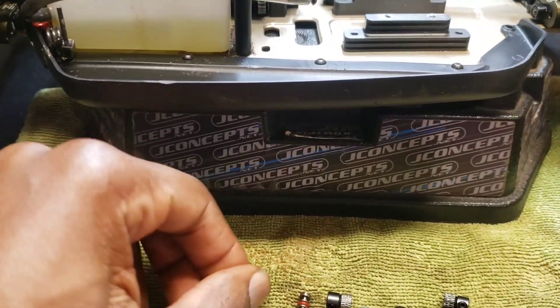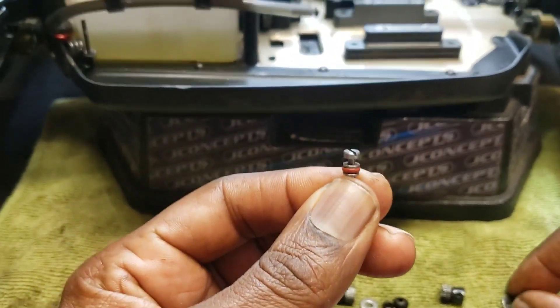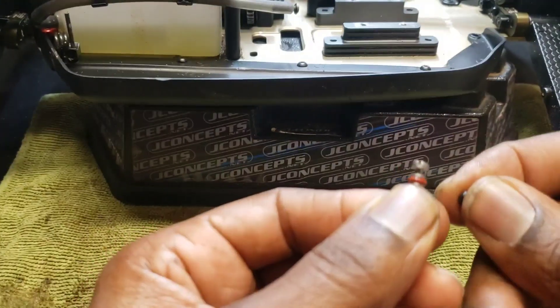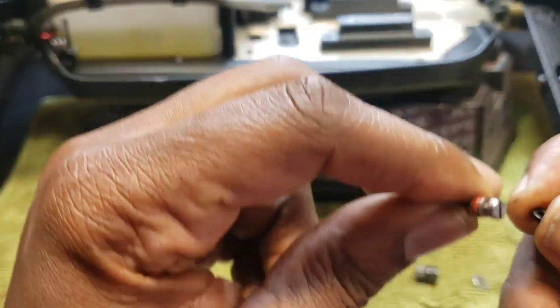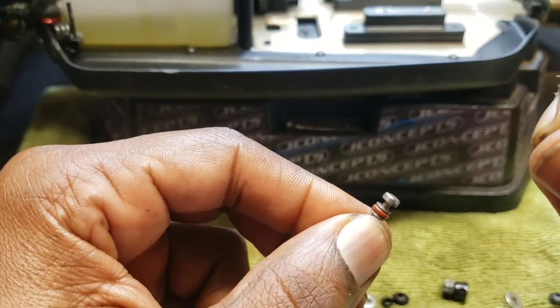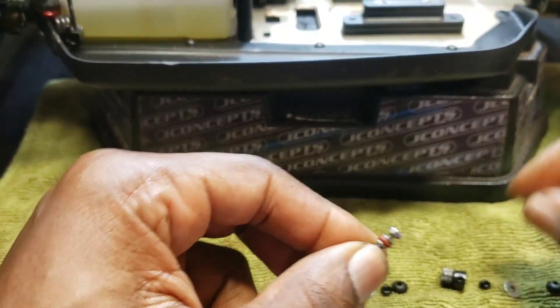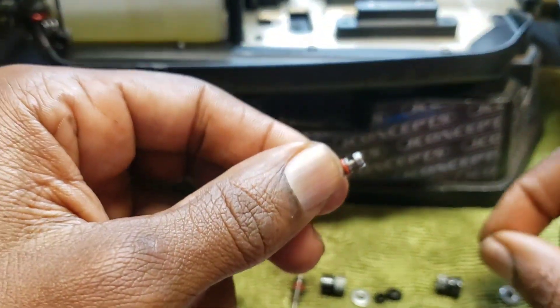What I did was I got some high-end needles. This is a high-end needle from an engine and I got the O-ring — the black O-ring — out of the high-end needle. It's right here behind the flathead screw of the needle. I removed this because this material O-ring is harder than like this red O-ring right here.